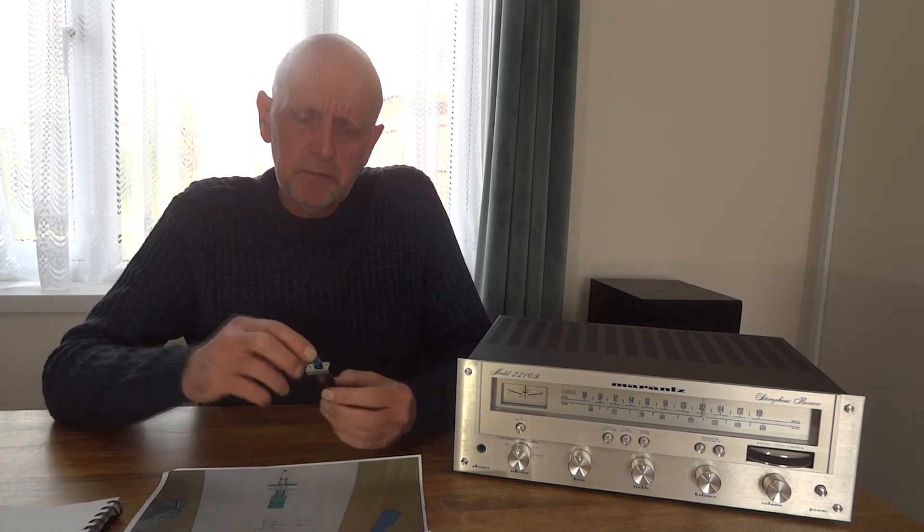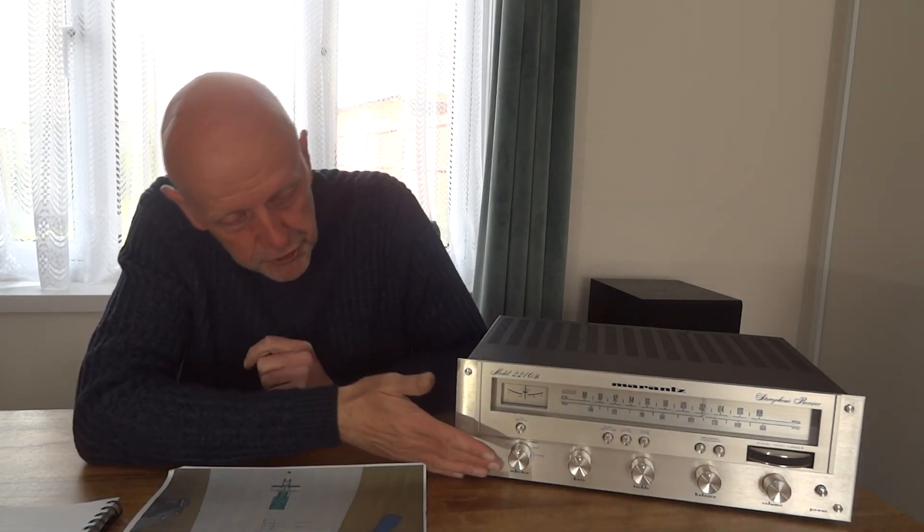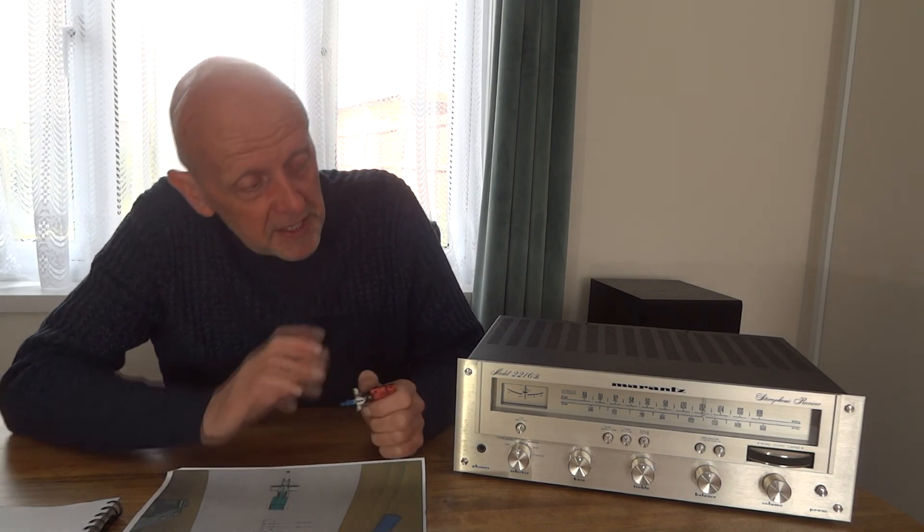Hopefully you can see in that test video it all comes on nicely now. I mucked about with the switch quite a bit — on and off, pushing it in and out slowly — and there's no more dimming. It's making a solid contact. One good thing is it fits nicely; you transfer the little silver button from the old switch to the new one and it protrudes exactly the same as before — not sticking out an inch like some replacements can. If I hadn't told you there was a new switch fitted, you wouldn't know.